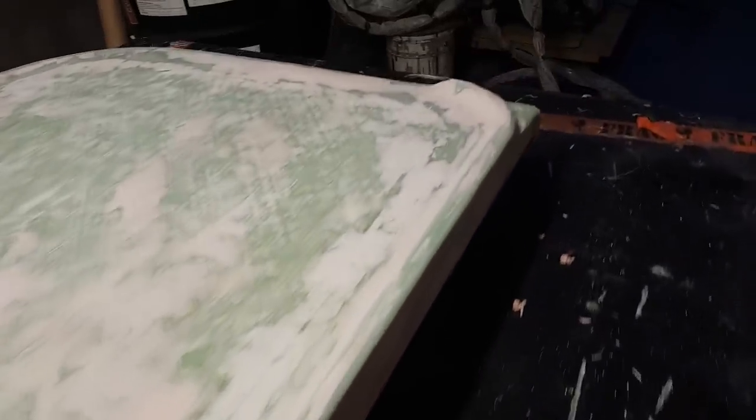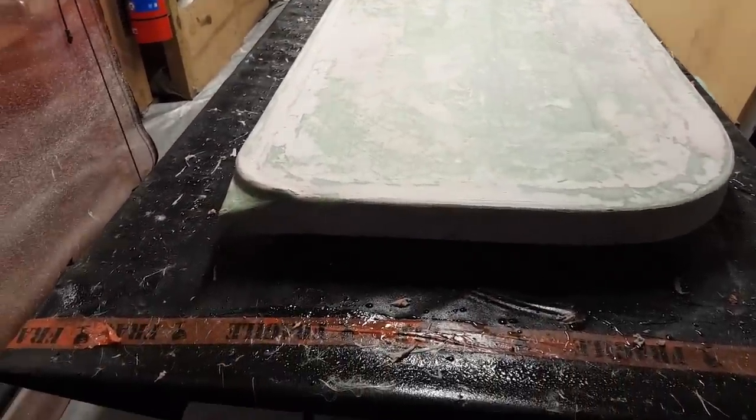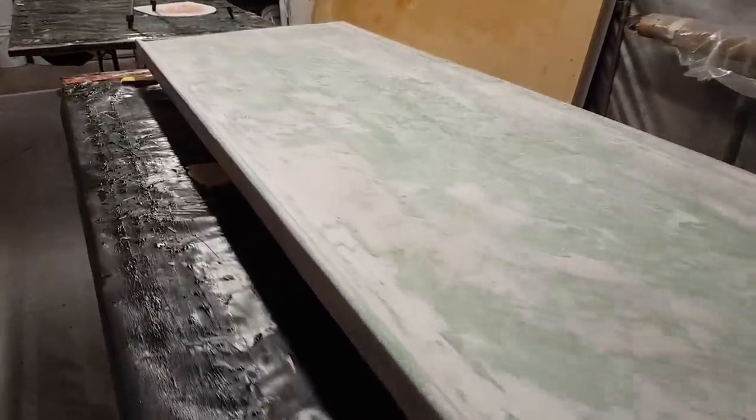We've already faired it twice and we have it almost down to perfect - if you run your finger along here it's smooth as a baby's bum along this drip rail. We're getting close to a finish that's going to accept paint, so we'll sand it up again, work through our sandpapers, get it all nice and smooth. A couple of areas still need attention but we'll do all that at once once we flip it over - definitely a better result than just relying on straight fiberglass.